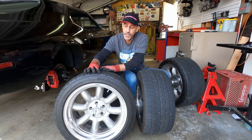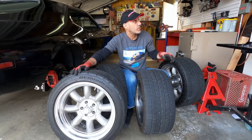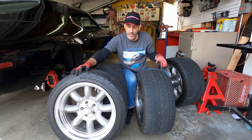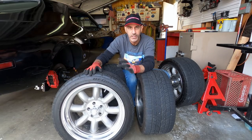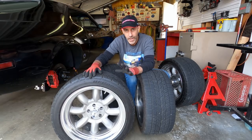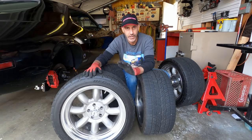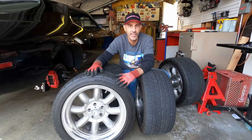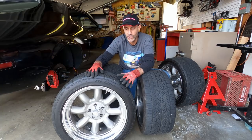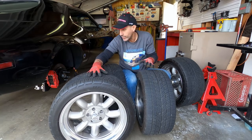And by looking at this sidewall here, I actually made a note to myself, try 30. I can actually go down quite a bit and gain a little bit more compliancy and a little bit of spread on the traction. I kind of kept it a little high because I knew I was going to hot dog it and fishtail it a little bit, and that's always a little bit nicer on your tires. It's just more gentle on them if you don't roll over the sidewall and you don't burn this off. So that's kind of one of those little tricks.